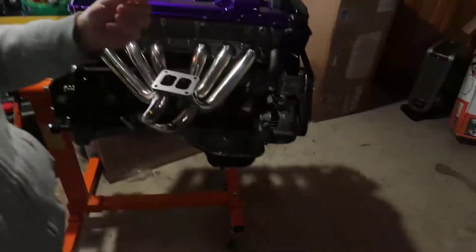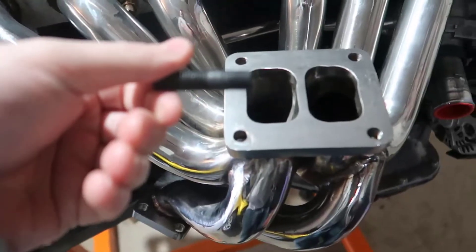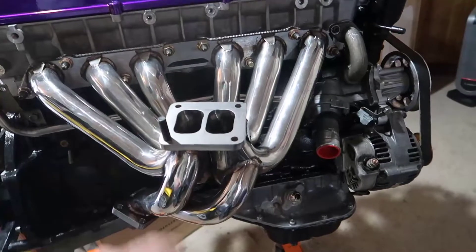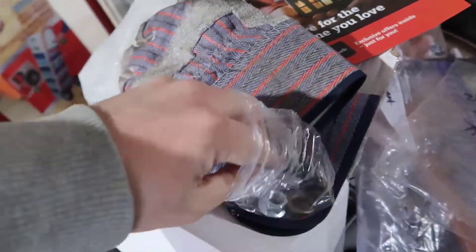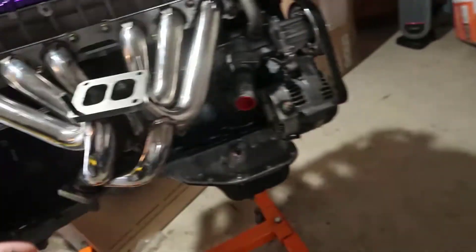First thing before putting our big boy in here, we need to put those studs in. I just got those studs — if you're interested, they are M10 1.25. There's a certain size here that fits on the bottom and it bottoms out, so our turbo goes right on top of it. That's going to be perfect. I got those at Ace Hardware Store. I might put a link in the description if I find them on Amazon, just so you can use it as a reference.